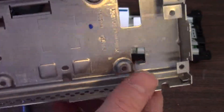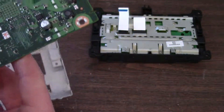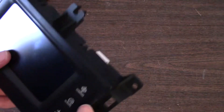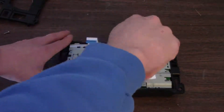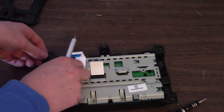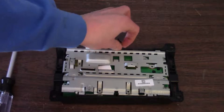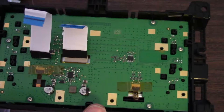It's not very much on the other side. You can see this little mark that they made where the CPU actually makes contact, and the aluminum frame acts as a heat sink cooling the chip down. You can also see here this looks like a testing port for testing the unit. Now here's the rest of it — this has the display and button assembly and it looks like there's another board under this steel bracket. Now that I've undone the snaps this steel bracket will come off. I believe this board would control the lighting for the buttons and the basic touch screen functions.